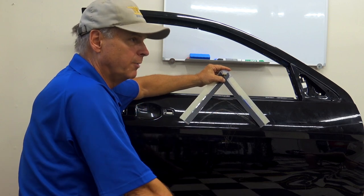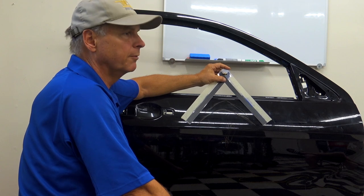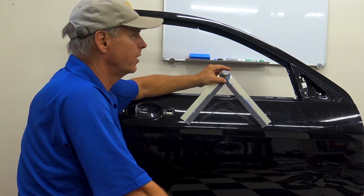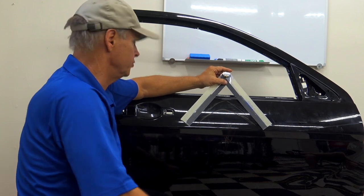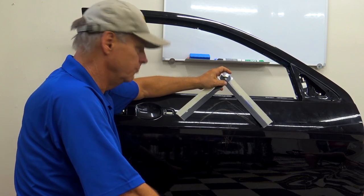Remember that video we talked about re-arcing the panel? That is an absolute classic re-arc the panel scenario. That's a pretty hard hit to do that with a hit on a body line, but you certainly do see it. And almost 100% of the time, you better re-arc that panel.